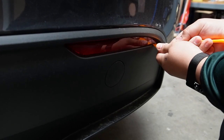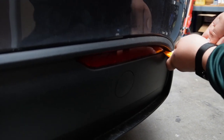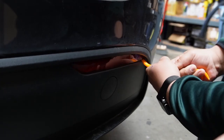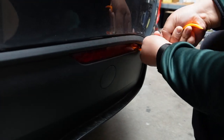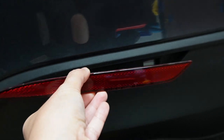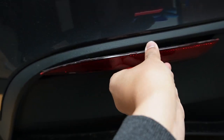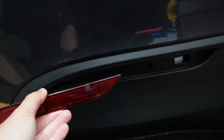This is how you remove the original OEM reflector. Since it's just a reflector, there's no power connected to it — just plastic and clips. Use a trimming removal tool and pull it out little by little so the clips underneath will be released. It's tricky to remove without breaking it. As you can see, there's one hook here and one clip hooking there — make sure you pop it up and then pull it out this way so you don't break it.